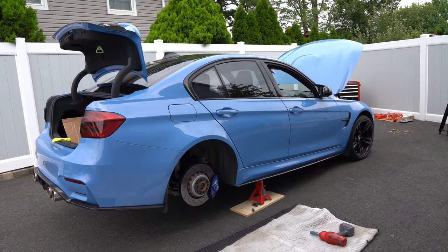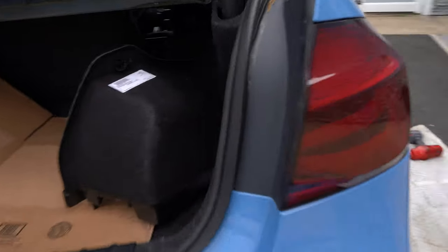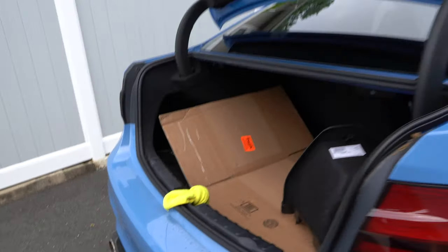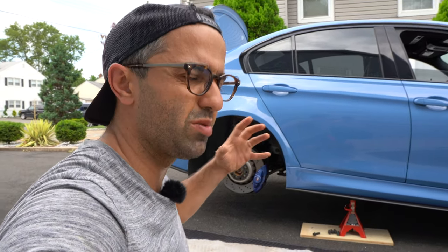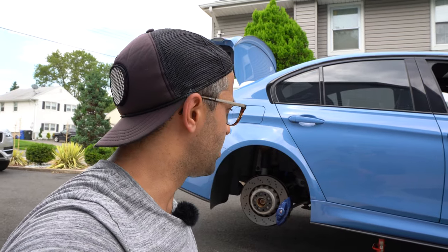I already jacked up the car, took the wheels off, put it on stands, and disconnected the battery because our shocks are electronic and we don't want to throw any error codes. By the way, put a towel on the hinge just in case you close the trunk by mistake. I've already done this type of work in the past, so I'm going to do this by myself first without the camera to make sure I don't miss anything, then walk you through the other side. The other side has one extra step — a leveling sensor — which is actually a better thing to show you.